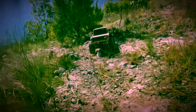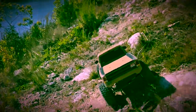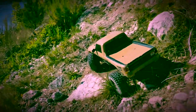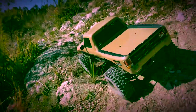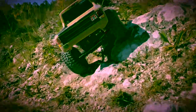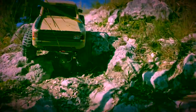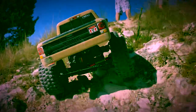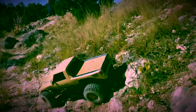One thing you may have noticed is that this truck has dual motors - one in each axle, 380 or 360 size motors. It has clod stall, which basically means you have one throttle channel running both front and rear axles. When climbing, all the weight is on the back tires and less on the front, so sometimes only the front tires are spinning - almost like having an overdrive. Sometimes you don't want that; you want the back tires to grip and pick you up, but pushing the throttle too hard can flip it over or just spin the front tires like crazy. So it's sometimes a great help and sometimes a hindrance, but I'd rather have it than not on this truck since it's so light.